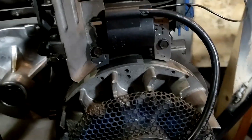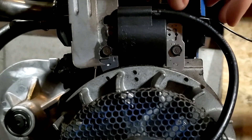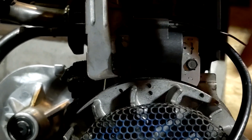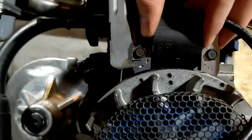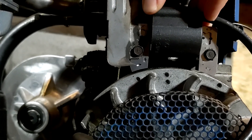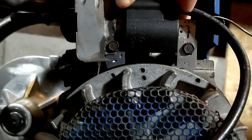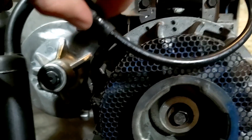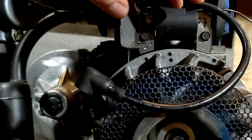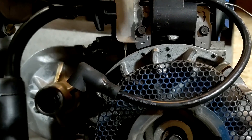Let's go ahead and get this new ignition coil on. I got the new ignition coil on there with the air deflector that cools the head. However, as you'll see, we still have a pretty large gap. It might make some spark but that's at the furthest adjustment down, so I'm still going to have to trim this a little bit. I just have to be more careful than last time — we're not down to gap spec yet, somewhere around 10 to 20 thousandths. So I'm going to modify this and try not to break it.